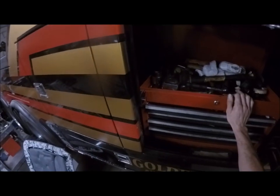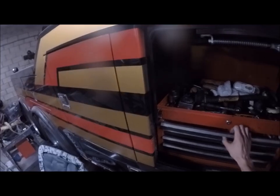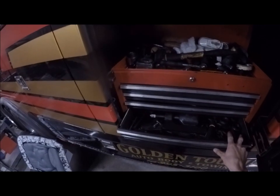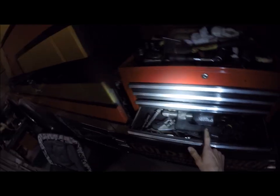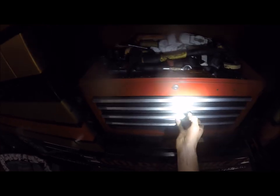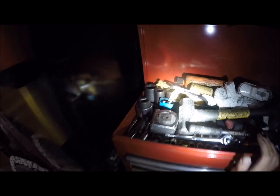This box here we've got our tool tray — basic tools to be able to pull drive shafts, cage brakes, and do whatever stuff needs to be done. One tool that we do have on this rack is this big guy. I'm not going to pull it out because this thing is giant. There are pressing caps on certain types of trucks and they're almost like welded in when you try to take them out. This tool makes it so much easier to pull those out — it's almost like butter. We've got some basic hand tools, a couple of knives, wrenches, air fittings, and caging bolts. Most of our general tools are relatively up here because they're just easier to get to.